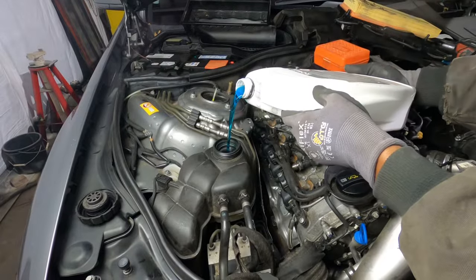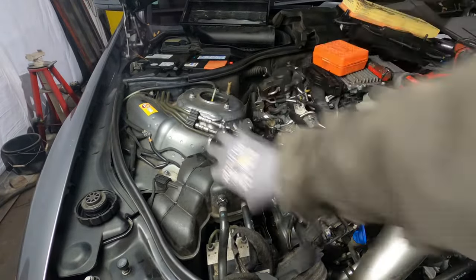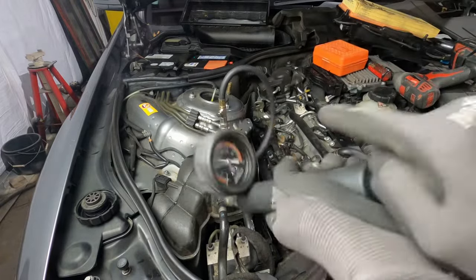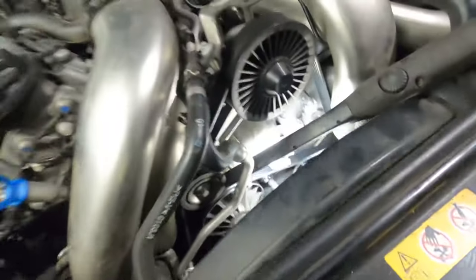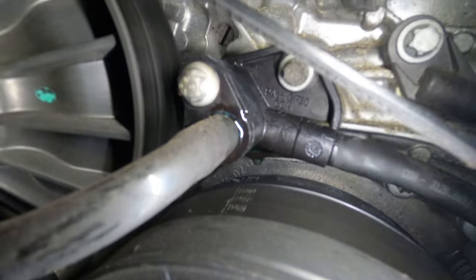It is low. Fill it up some, add your adapter to the top, and pump some pressure into the coolant bottle. Give it a few firm strokes — right around 15 to 20 PSI. Afterwards, start looking around for any drips or leaks under the car.